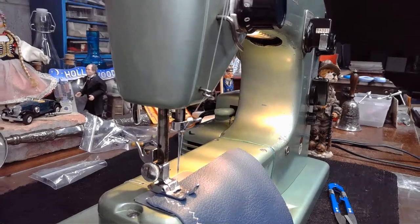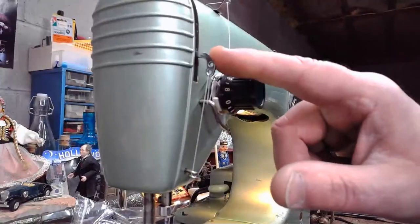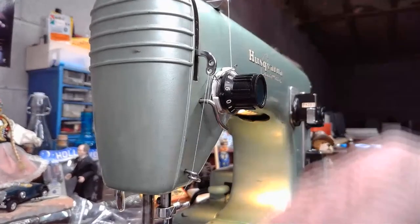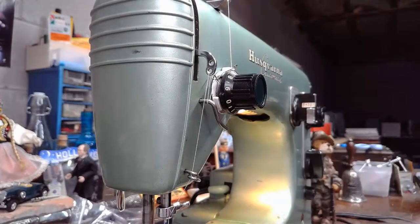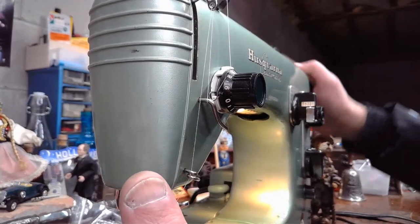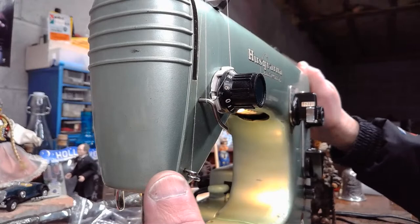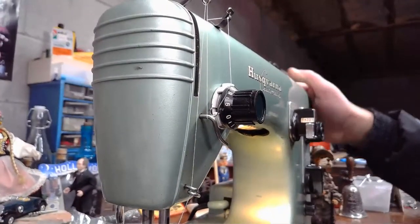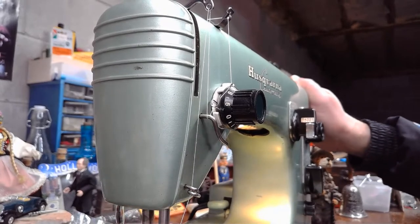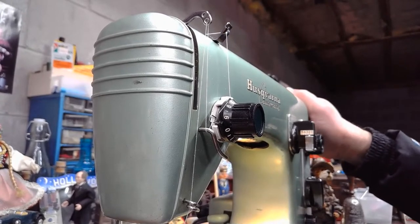Yeah, Emma got it. I don't know if someone got it before Emma, but Emma noticed that right now our take-up arm is at the lowest position, which means right now the mechanics of the machine are in a sewing mode of motion, of inertia, of energy, and it's flowing through that sequence. But when you're initially launching, you want to have that take-up arm all the way at the highest position, ready to downstroke. Look at that take-up arm closely. See how it's ready to downstroke? Let me raise it a little bit higher. Sorry. Still don't have it high enough. Hold on. Now it's ready to downstroke. See how it's starting to come down?